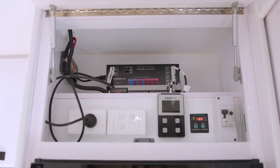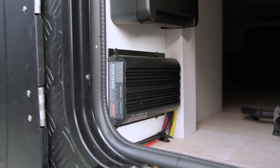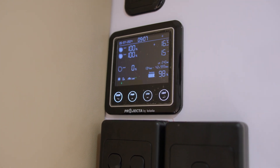Inside this caravan, I'll just touch on the monitoring system. This van came factory with a Projecta system — the main brand unit up in this cupboard here does all the fusing, pretty much your AC charge and solar operations as well. Now being we've gone over to lithium, we've fitted a Redarc BCDC 1240 up the front for vehicle charge operations. We've managed to integrate the lithiums into the Projecta — this unit is lithium compatible so we've just had to upgrade the settings. Because we've put in a large inverter as well, we had to fit a Projecta shunt — that's Projecta's dedicated battery shunt — and we wire the inverter load through that to ensure the Projecta screen calibrates and reads true.